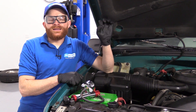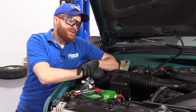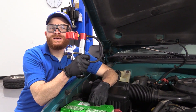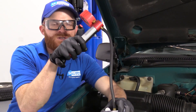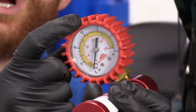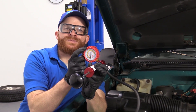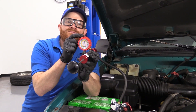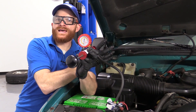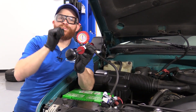If you notice a coolant leak that's dripping on the ground, it's probably going to be fairly easy to find. If you can't find where the drip is coming from, you might need a pressure tester. You just screw it right on, pump it up to approximately 15 to 20 pounds of pressure, let it sit for a little while, and watch if that gauge drops. If the gauge goes from 10 to 9, 8, all the way down to 0, you know you have a leak — and more than likely you'll see drips on the ground.